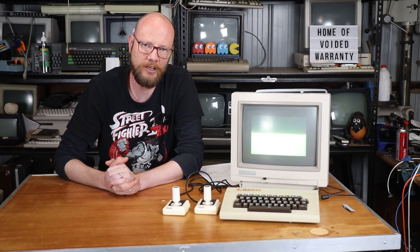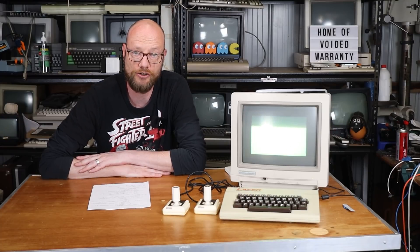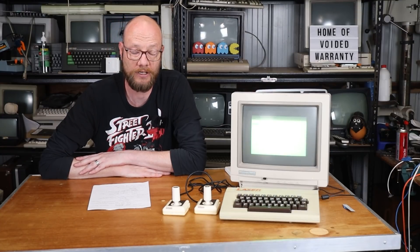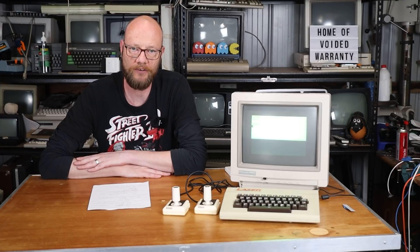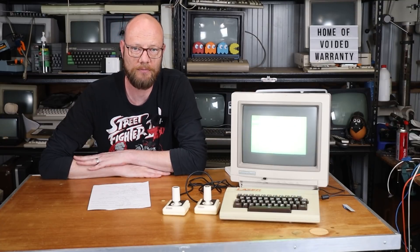To give a quick rundown of the history of this computer — and I have notes — the VZ200 originally hit shores of Australia around 1983. It was first advertised in Electronics Australia in June of that year, with the VZ300 coming later in 1985. The main difference between the two: the VZ200 only had 8K of RAM, while the VZ300 had a whopping 16K, both of which were expandable with memory upgrade cartridges. The only real difference between the Laser 210 and the VZ200 was that the Laser variant only came with 4K of RAM, but the VZ300 and the Laser 310 were identical apart from the sticker.